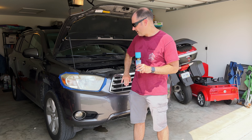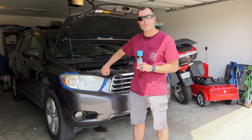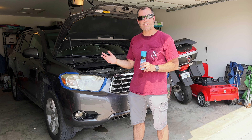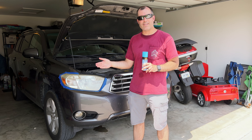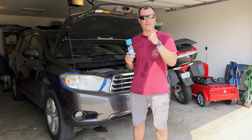All you do is make a pass across the headlight, make sure that each time you make a pass you're overlapping. After you get the headlight fully coated, wait three to five minutes. After that, apply one more coat, wait three to five minutes, then it should be dry to the touch, you can remove your masking tape, and then after 24 hours this coating should be fully cured.